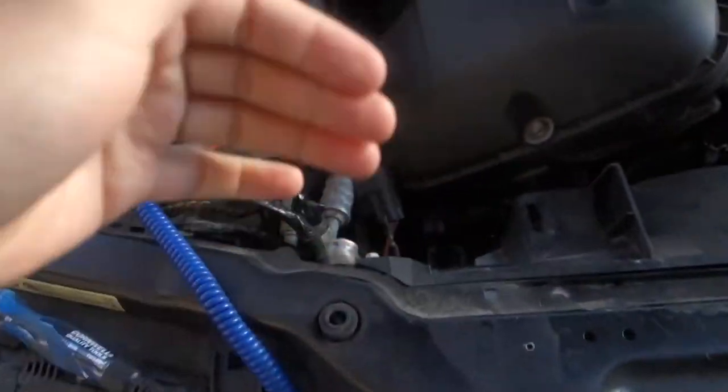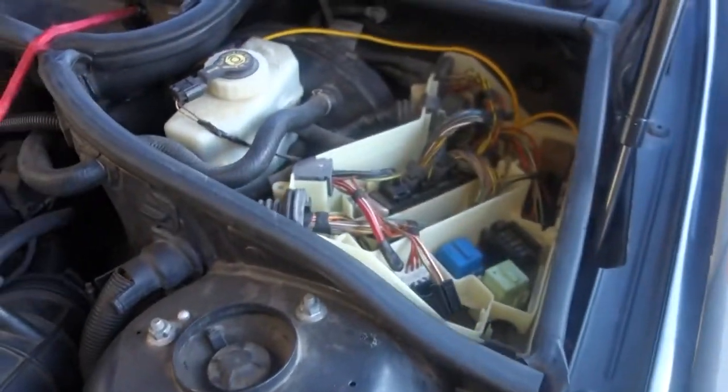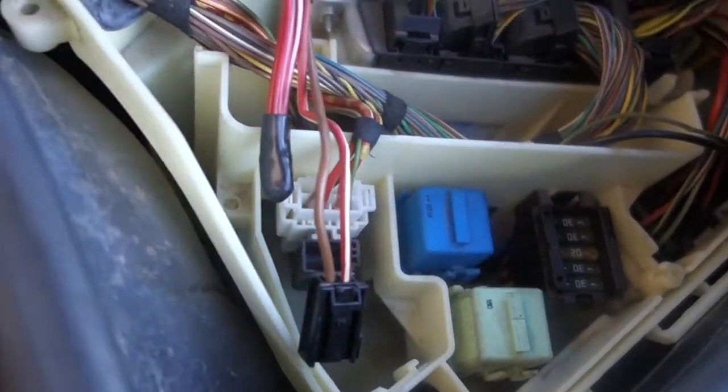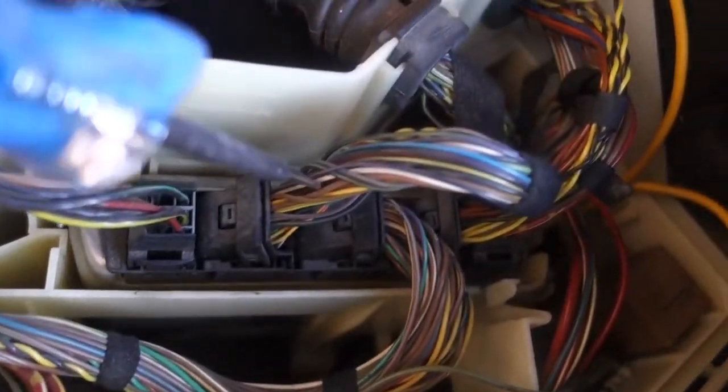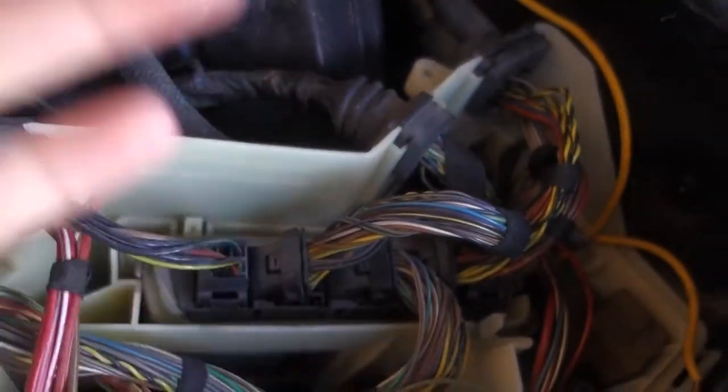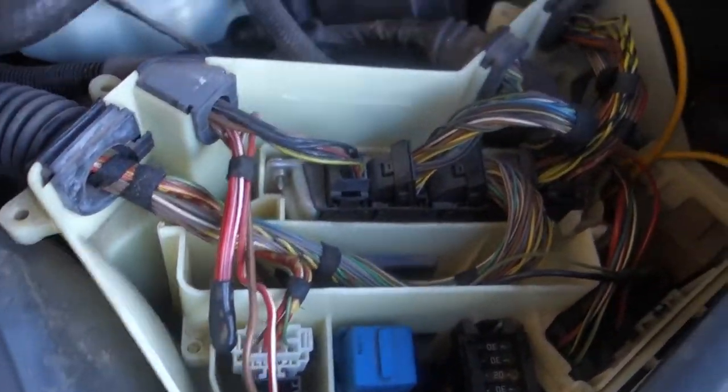So what we figured out is why they made this wire — it came attached, and they cut it from the brown wire connected to this control because it was getting constant power. When I put these together, the fan should have turned on. What they did is a substitution — they cut that off. So right now it's not working because we cut off the main power source to make this wire hot. We have a fuse box inside, what I'd call a wire junction box, and we checked each and every one of these to find out which had power running constantly and which only got power when you turn on the battery.